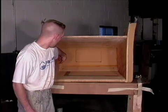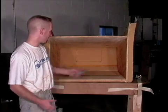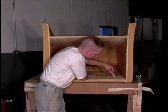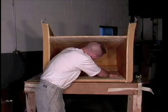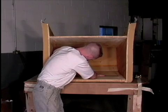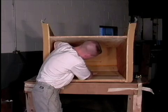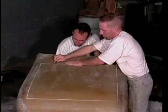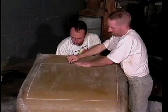I've marked out the trunk lid size one inch smaller on the inside than it was on the outside. I'm now going to take a razor knife, follow this straight edge, and make a cut through until the blade hits the fiberglass on the outside. I'll do that in all dimensions. We're actually trying to run a knife directly underneath the fiberglass to separate it from the foam.